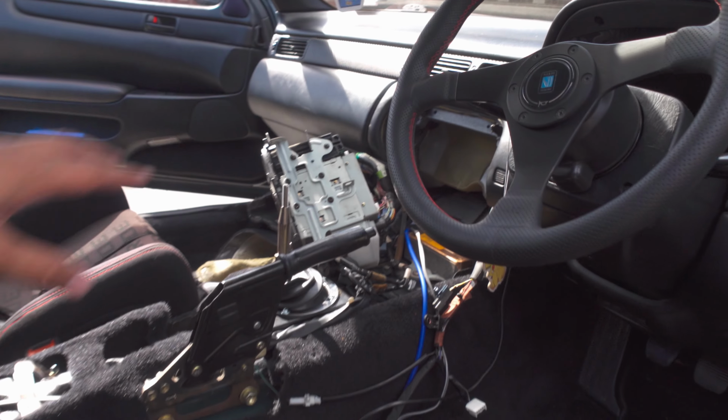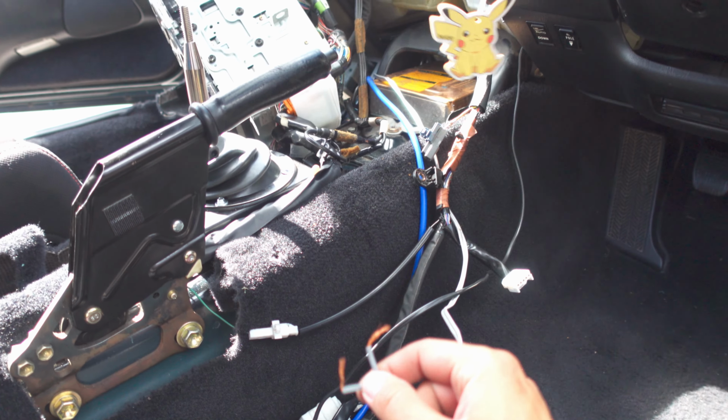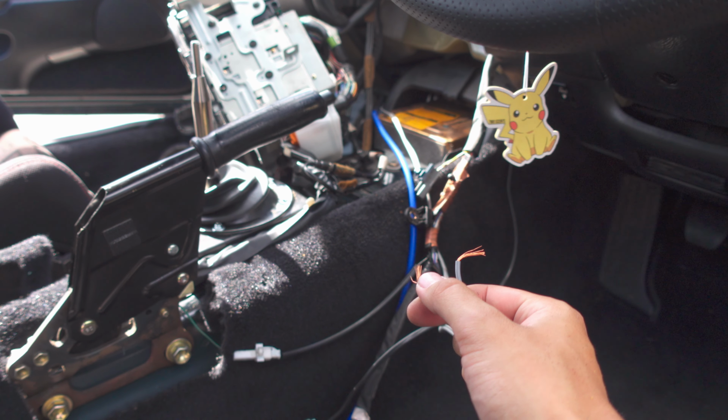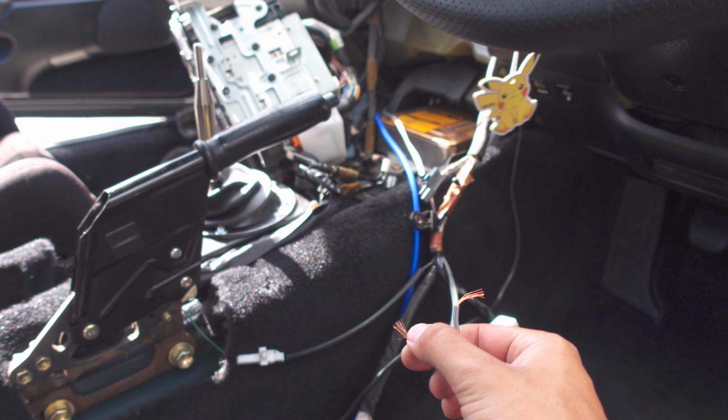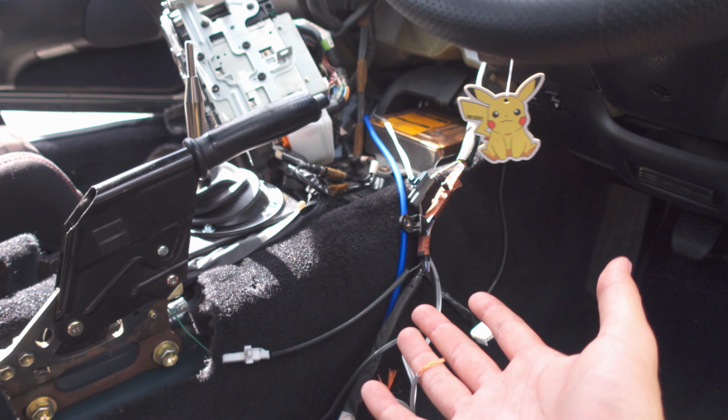putting all the center console in, getting all of this wiring done, hooking up the boost gauge, and getting this ready, which I'll need to short together to start the car. I do have a clutch switch, but for whatever reason it's a push to close, not a push to open switch, which I'm not sure why they would make it like that. I'm either going to have to open up the switch and try and figure out if there's a way I can easily swap it over to a push to open switch, or build my own circuit with a transistor to make an electronic switch that's the inverse of the push to close switch.